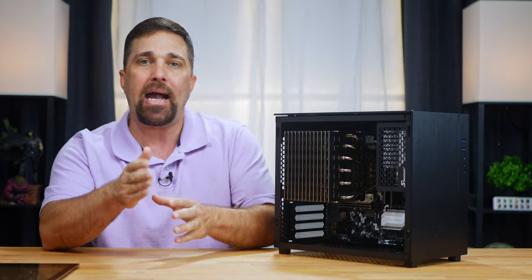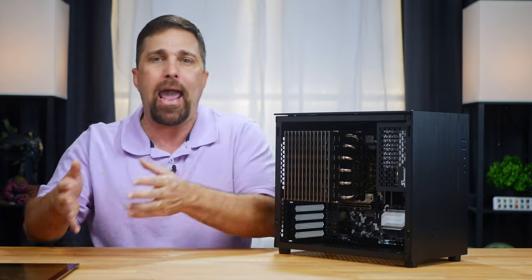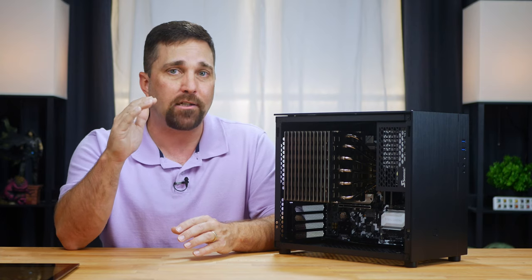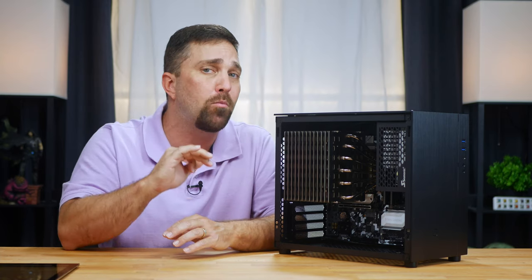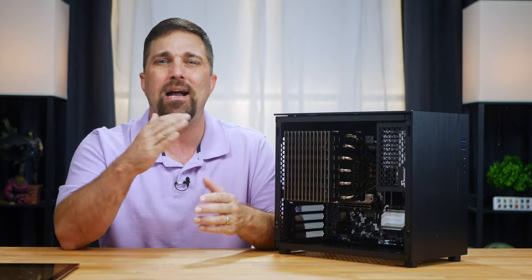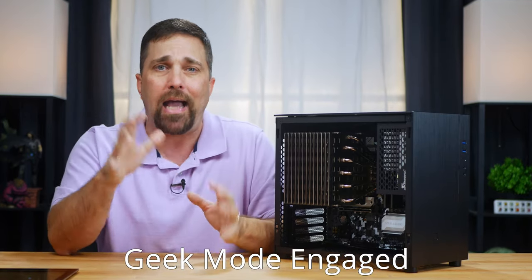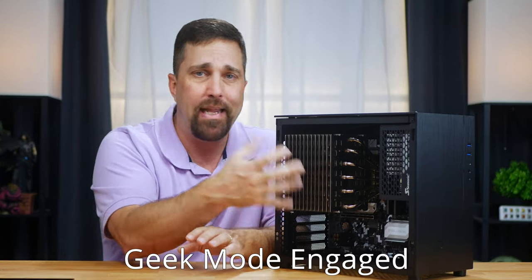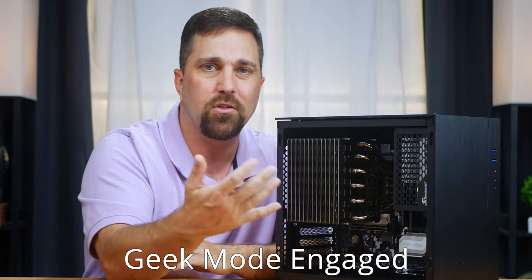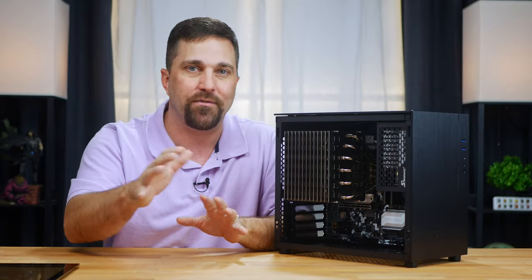However, getting back to idle temps after running a test, it obviously takes a bit longer than an active cooler would, but the temp does drop from, say, 75 degrees actual temp down to like 55 almost instantaneously, and it takes about 5 minutes or so to drop down to the 45C mark because, you know, physics, convection. The hotter the heat sink is, the faster it cools. It heats the surrounding air faster, which rises faster and is replaced with cool air faster. As the metal cools, that all slows down, slowing the cooling. Sorry, I regressed into my former life as a physics instructor.